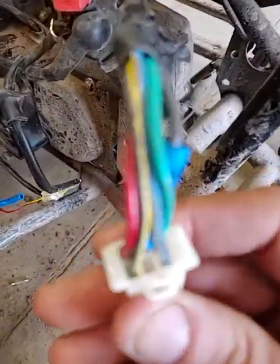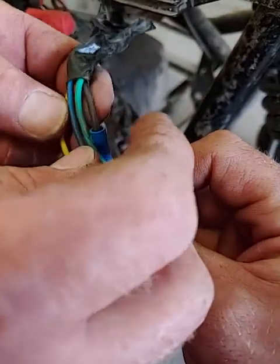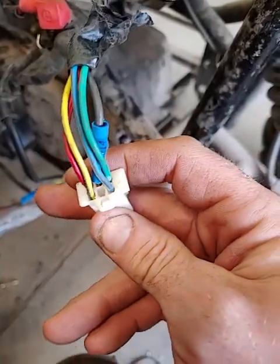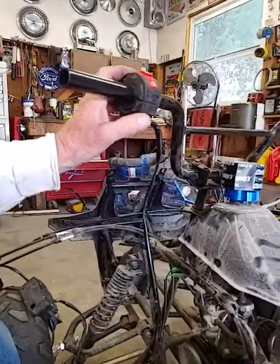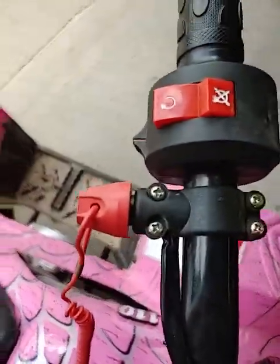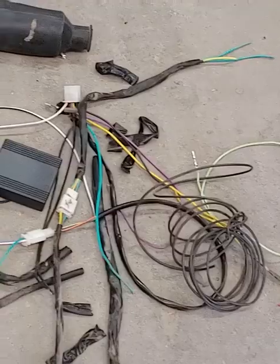All four outside wires — left upper/lower and right upper/lower — are already going where they need to go. The black and white is the safety wire throughout the whole system. If your brake lever isn't depressed, that's your black and white wire. If your little lanyard that you're supposed to hook to your body in case you fall off — that's black and white wire as well. All the black and white ones are the safety system, and they're all gone now. That's all the safety junk we got rid of.